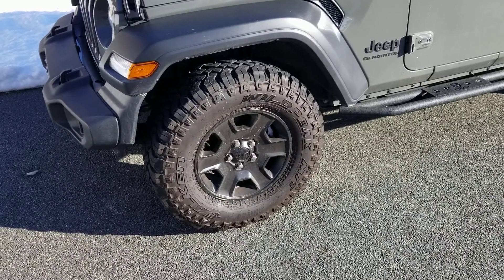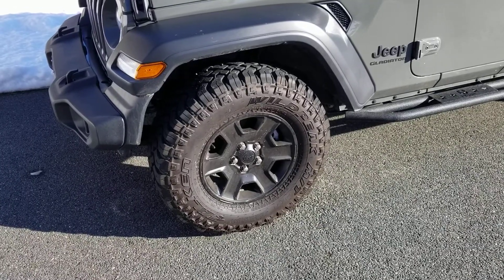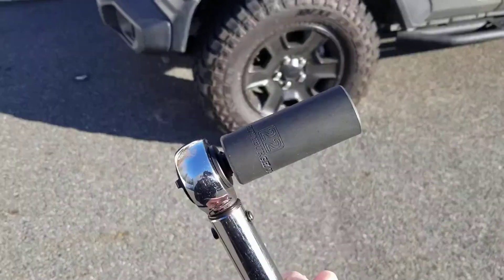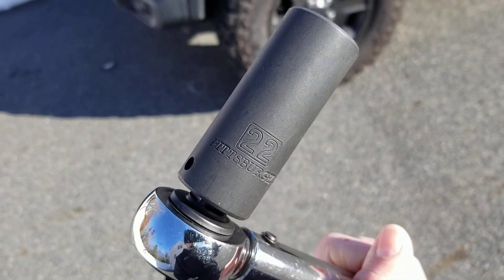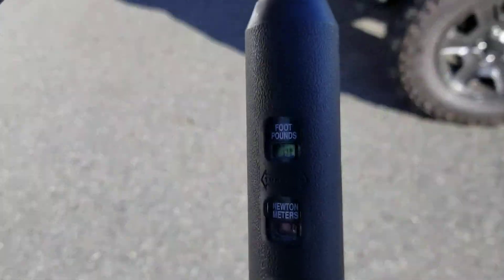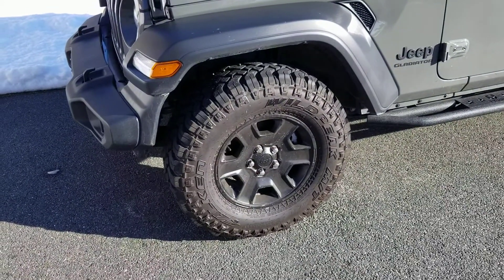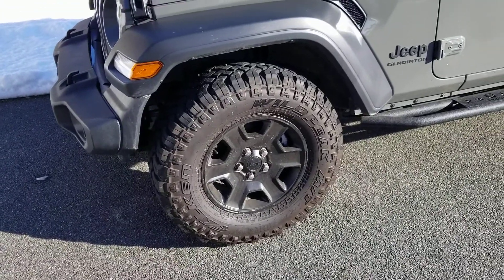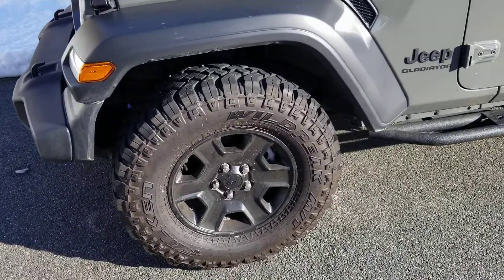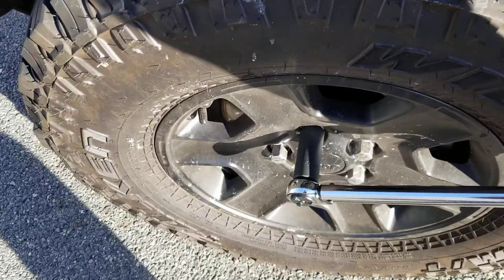What's going on everyone — just a quick video. I'm gonna re-torque my wheels here. I already got the torque wrench all set: 22 millimeter at 130 pounds. See that? Yep, 130 pounds. So I'm just gonna go around and torque all the lug nuts back down to 130. Shouldn't have any issues, but let's see.